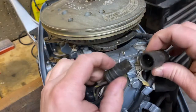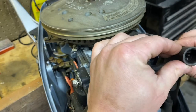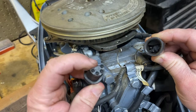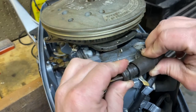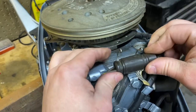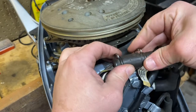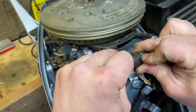Now I'm going to put this all back together. Make absolutely sure you're not jamming anything — there's a bit of a stop at the top of the inside and it corresponds with a flat on the other side. Make sure they go back together just like that; they should just slide together. Don't force it — if you're forcing it hard, something is misaligned. Put that back together, get the clip back on, and we're going to move on to the next system: the coils.